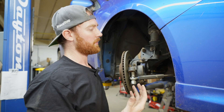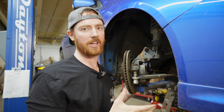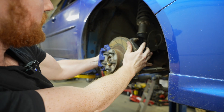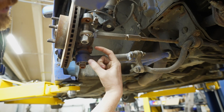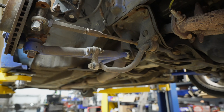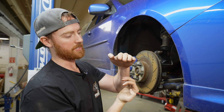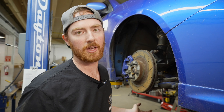There's more to it than that because caster raises and lowers the outer tie rod, and a couple of other kinematics change it, so it's not going to be exactly that. But I can already tell that he probably had some bump steer issues just based on the difference between these two points and these two points. Right off the bat, that probably would have been corrected just by reducing the caster, because that would have lowered the outer tie rod relative to the control arm.